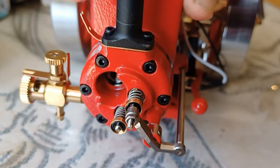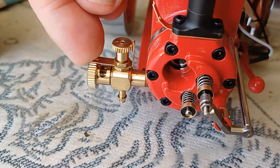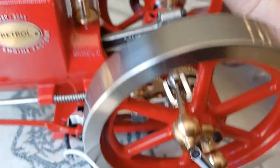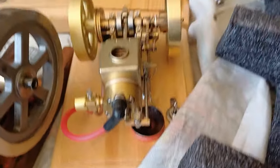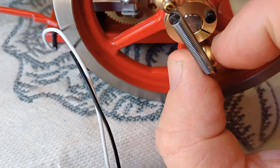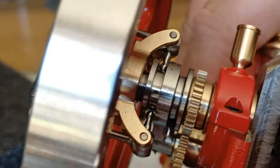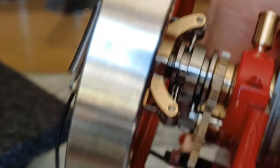Carb looks nice. Conrod here. That looks like stainless steel or steel to me — it's not aluminium like this one over here, or brass like these ones. So far, just a real step up. Look at these big balls here. Fairly loose — the spring is fairly loose, which it should be. For the high wear parts in that governor mechanism, the pins and the pin slots on there are steel. Just great to see.